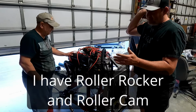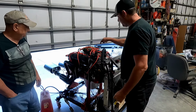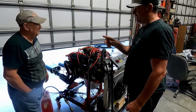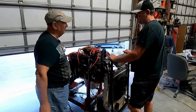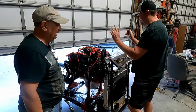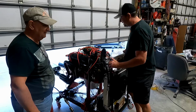But the real deal is we went through and checked firing order, and two wires were off. We have 3 and 4 reversed. Firing order is like 4-3, and we had it 3-4. So they were crossed, one on each side, so they'd load up with fuel and pop. So we had a 6-cylinder for a while. Yeah, we're going to hear a V8 today, hopefully. Yes, sir.